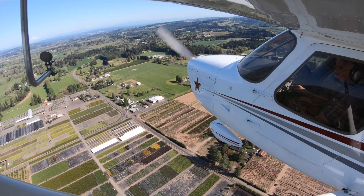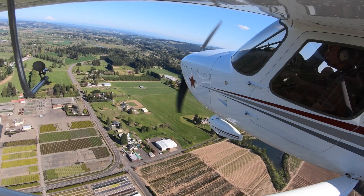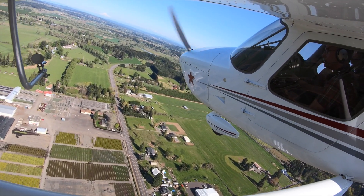That's a little bit of flying with the GI-275, both as the ADI and the MFD. I hope that gives you a little insight into what these things are like to live with. It's a really nice instrument — probably a little expensive for the experimental builder, and it has a lot of connections that a typical homebuilt won't use. But as a platform for a really nice small-scale EFIS, it really impresses. The display is amazing — great resolution, terrific brightness, the unit feels very robust, and it's got a ton of capability. Whether or not it's at the right price point for you, Garmin has made a really nice unit here. I'm Mark Cook with Kit Planes Magazine — thanks for coming along for the flight, and we'll see you next time.